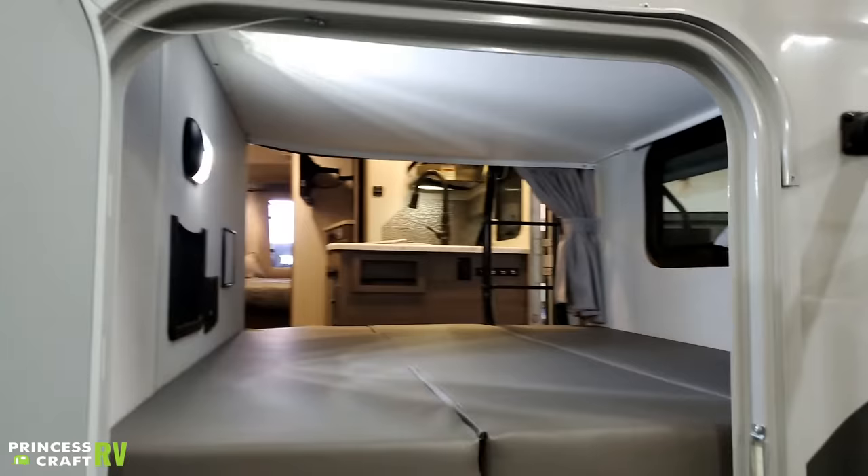We have your cooktop here. Turn it on, and then you have an igniter — go ahead and turn it to the high position and hit that igniter to light the burners. The oven is lit a little differently, just like you would light any other pilot light. Switch it onto pilot, hold that to allow the gas to flow through the line, then take a long-stem barbecue lighter. There are two prongs — one is the actual propane line and the other is the thermal coupler. Put your flame directly in between the two while holding the pilot light, hold your flame there until it lights up, then hold that pilot light for a few seconds longer to allow the thermal coupler to heat up. You can then turn this to your designated temperature and use it as designed.